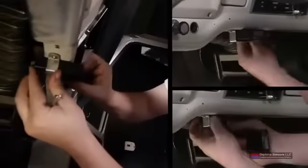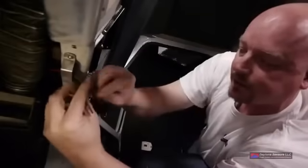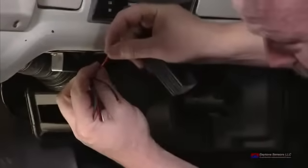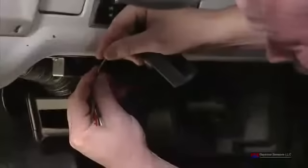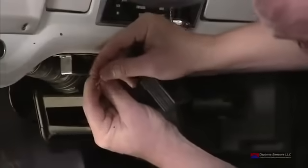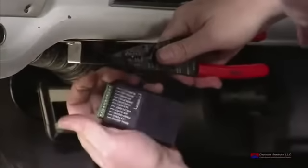For this step, we're going to install the wiring to the control unit. We'll loosen our bracket up just a little bit and pull our wiring harness down that we routed through the firewall earlier. For our wiring, we have a switched 12 volts — this should be connected to a good battery voltage source that is only on when the key is turned on — and a battery ground, which should go as close or directly to the battery as possible. We also have the five wires for the sensor harness. On the back of the controller, it gives you all the information you need for wiring, including where the battery power, ground, and switched 12 volts connect. We'll start stripping the wire back and connecting to the controller.